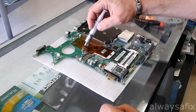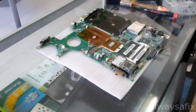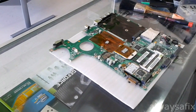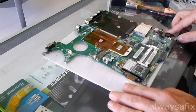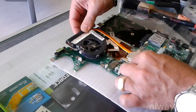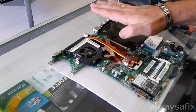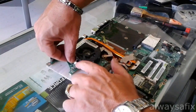There are numbers here — one, two, three, four, five — that's the order in which they want you to tighten up the screws so that you end up with an even mount on the chip. Don't forget to plug in your fan because that's underneath the motherboard and that would be disastrous.